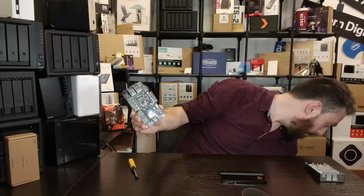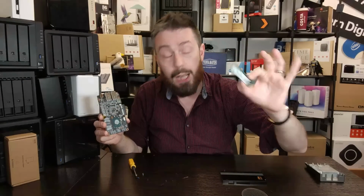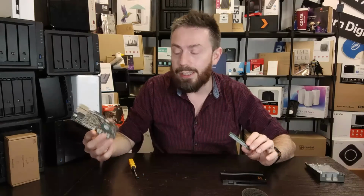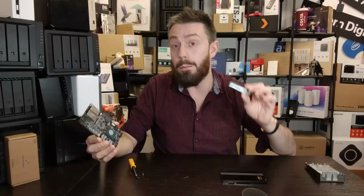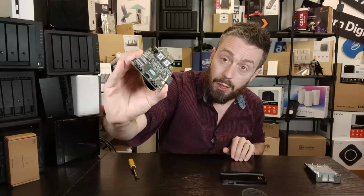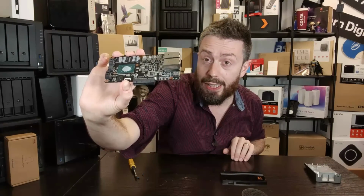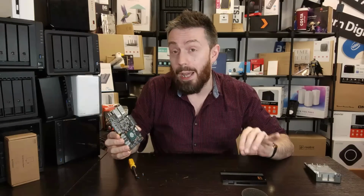To put that into perspective, if you were to go ahead, and even if you chose to go mSATA or M.2 NVMe, if you wanted to bump this up to 128 or 256 gig, it would have added another $30 to $50 to the price on this because of the price of the NAND individually. And because they've got that scalability to add the additional SATA storage, to add USB storage, to add some kind of PCI connected SATA hard drive cage, I can see why they've done it, but there's no avoiding that that is a fairly modest amount of storage.